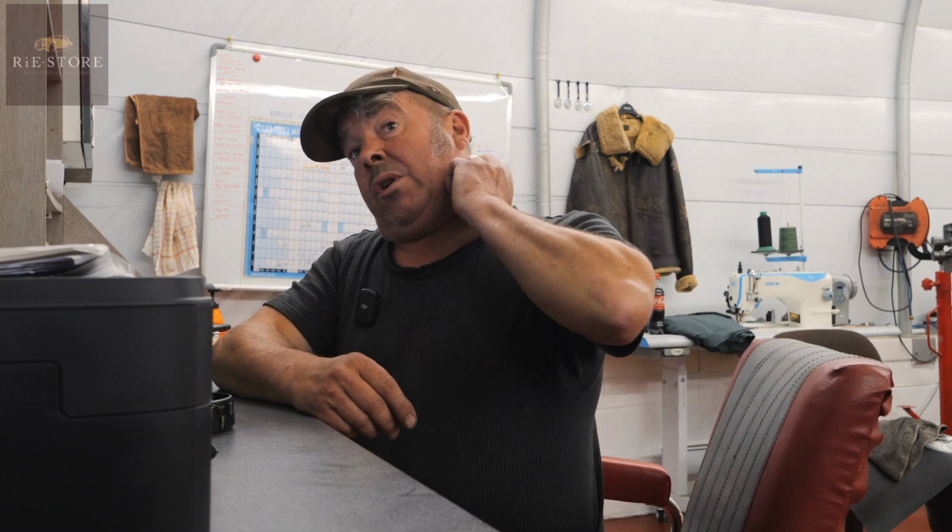You can get what they call exhaust assembly paste, which is liquid, not like the old stuff called Dum Dum, which was hairy, just basically for filling holes. But basically they leak. Even if you pin them and put a pin in there, that will stop it falling and rattling and jumping up and down. Because they were ridden long and hard and all day, and Harley Davidson recommend them running rich, they just fill up with carbon eventually and stop it leaking.